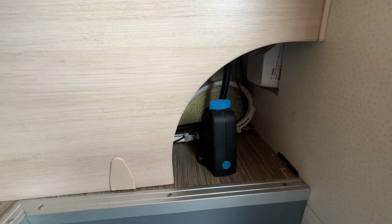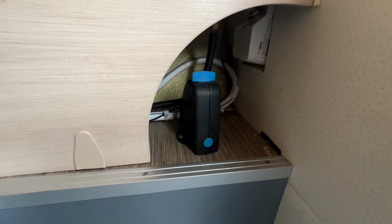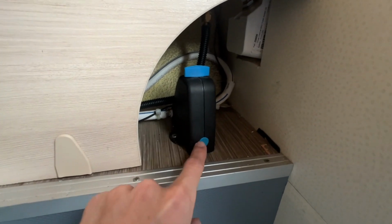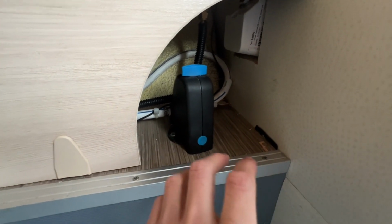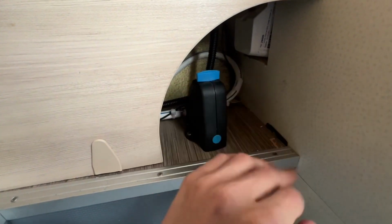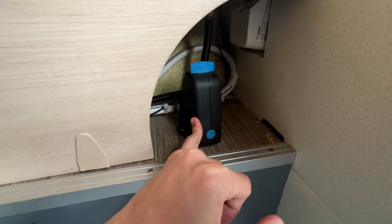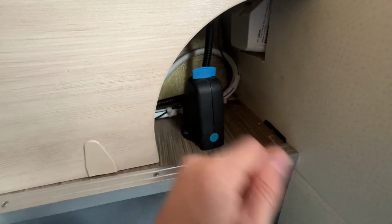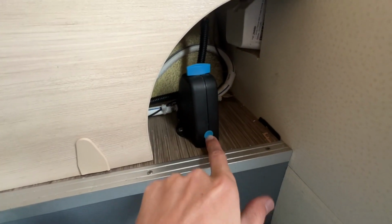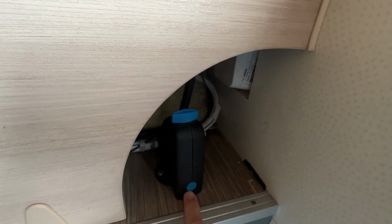However, if you were using it in the winter and you've drained it down and you've then thought, oh, we'll have a quick weekend away, and you can't get the button to stay in, just put the heating on without the water for around 15 to 20 minutes first. This area will get nice and warm, and then just come in and push this button, because this will be still sensing the cold. Other than that, you can use a hairdryer to heat the area and push the button in. So that's closed when the nib is flat and the button's pushed in.